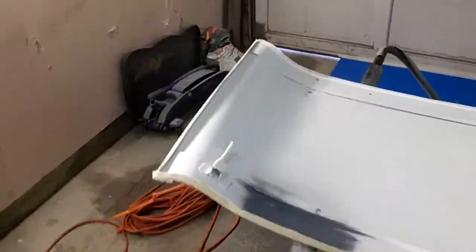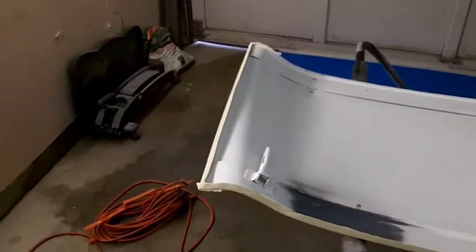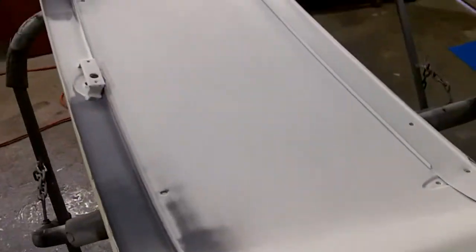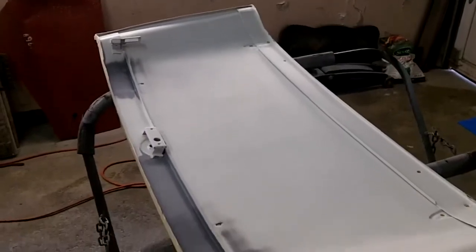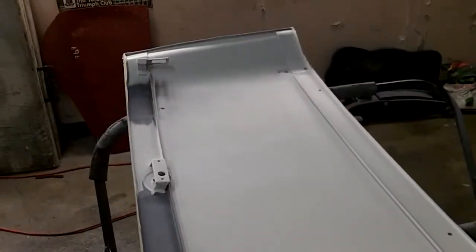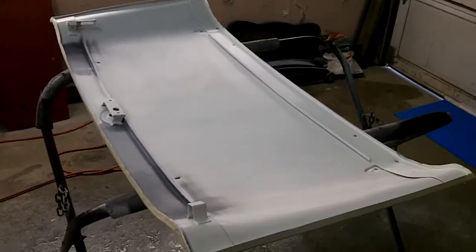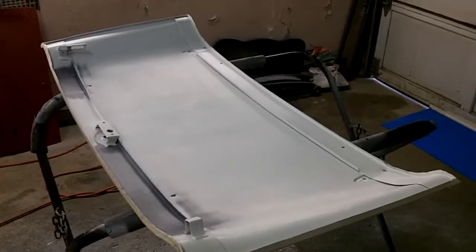Quick update. It's about a quarter to four and we've got the trunk lid sanded down on the bottom. We've got the top taped off. We've got our wipe down with wax and grease remover. So I think we're about ready to spray another panel. I think what I'm going to do is move the hood around to the side of the house so I can put the fans back out front and not worry about blowing crap on top of the freshly painted hood. Then we'll get down to spraying this one. This should be a fairly quick and easy one, I would think, although it proved to be a little difficult the last time I tried it.